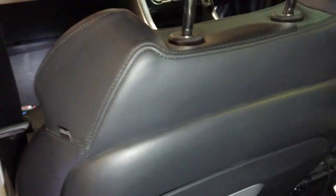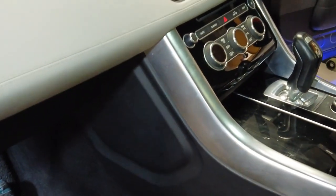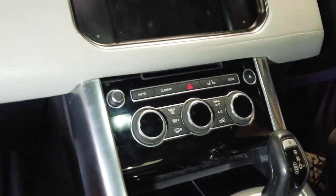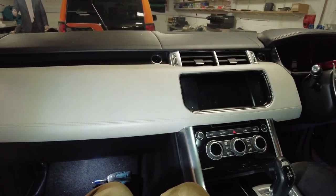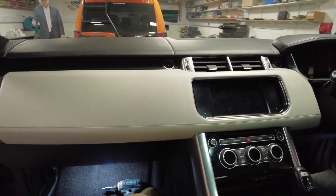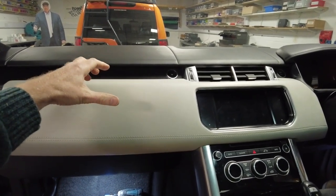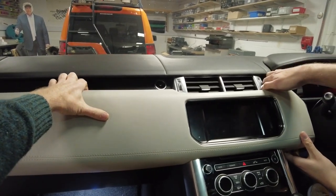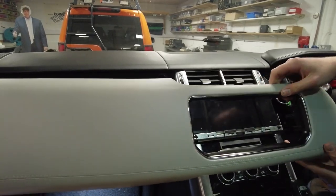Let's jump to the front. We've put the seats right back so we can hopefully give you a good view. This wide angle is pretty lush for this. So this front panel — you've got to take it from the top first. Grab the top your side and rotate it down, then go down. And that's it — that comes away.